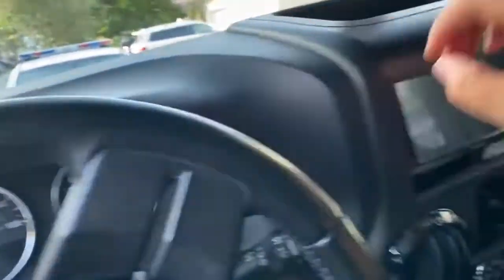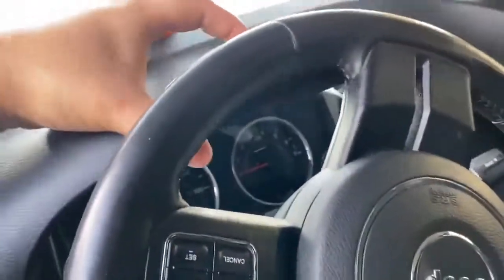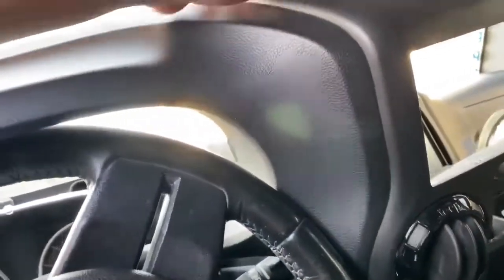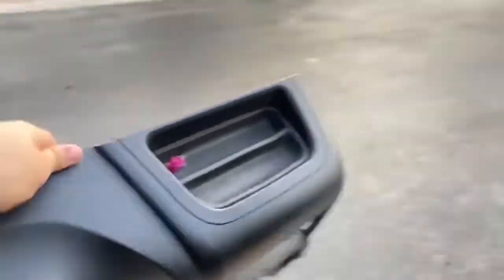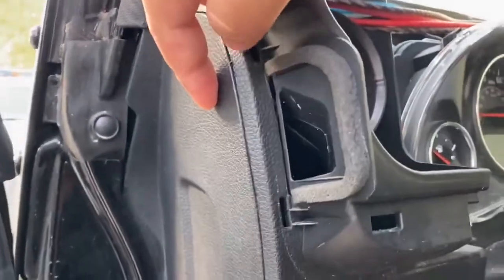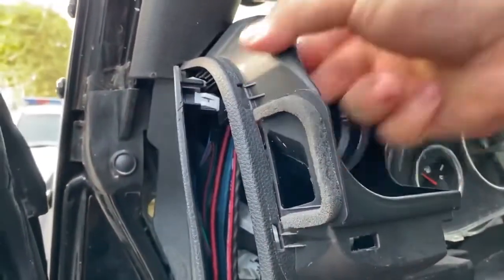Move the harness out of the way so it doesn't get caught up. You can pull the dash out from any side you want — I like doing it from the top. Just connect that side. The radio side is going to have to come up first — just like that, it comes right out. You might have to play with it a little bit. Put this aside, make sure it doesn't crack. Then remove this center panel — since you already removed the dash you can just put your hands in and pull it out just like that.